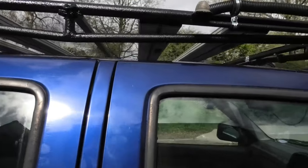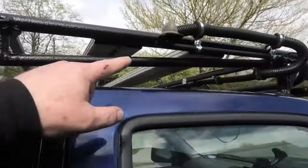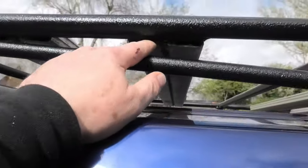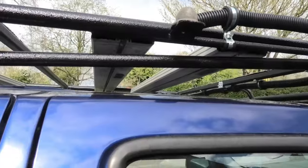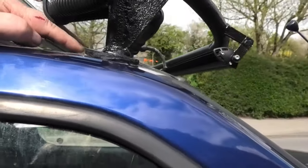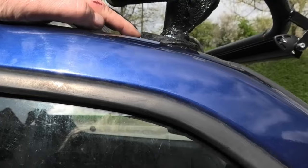Those holes — well, you get a side wind and it's like 50 bottles half-filled with water with the wind blowing over them, making a hell of a racket. So what I'm going to do is take them off — all four of them, those two and those two are coming off. We're going to put some foam filler in there and then get some Tiger Seal and literally glue up the ends as neatly as we can on both sides. That should resolve that problem.